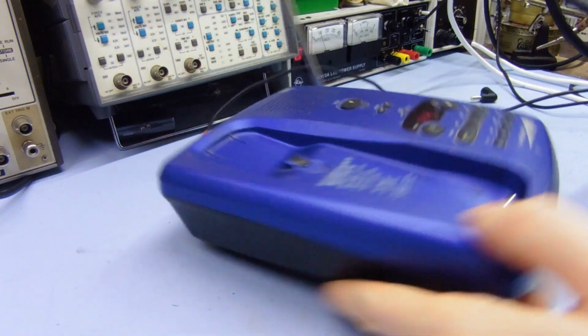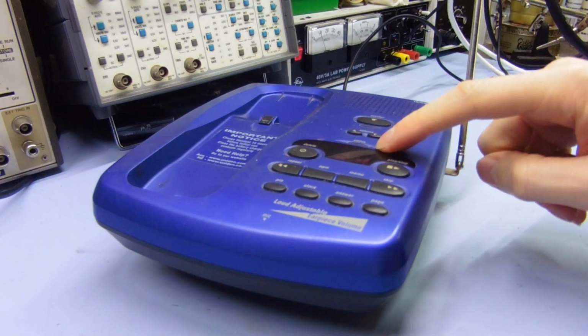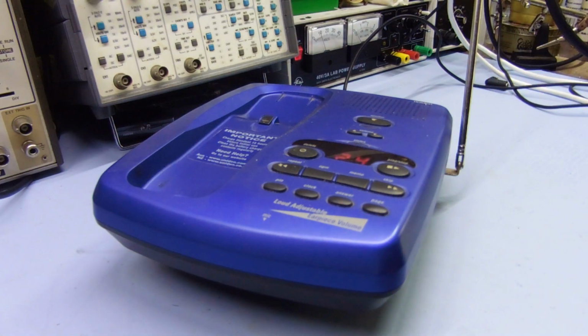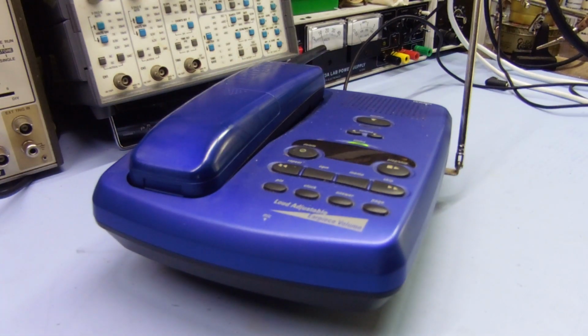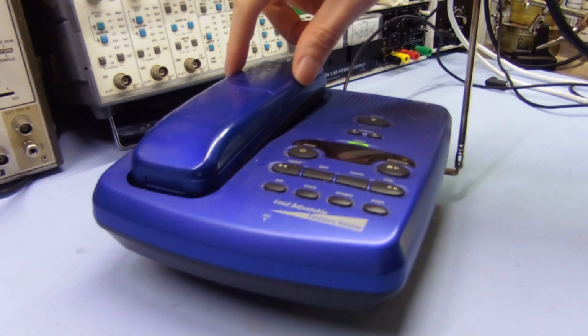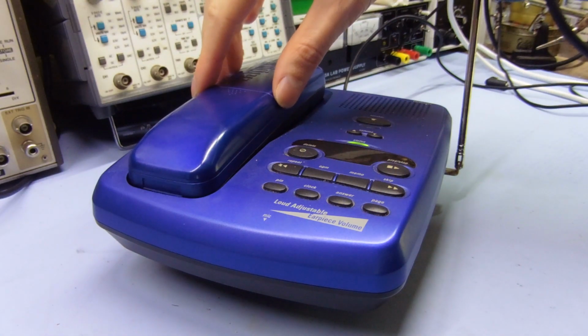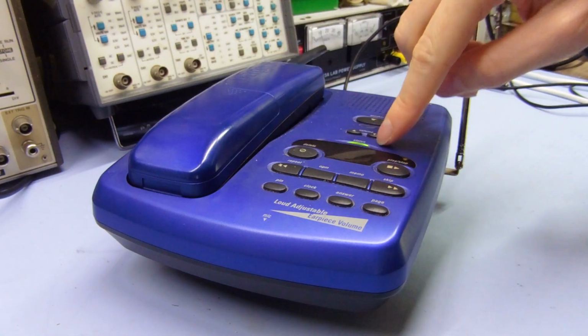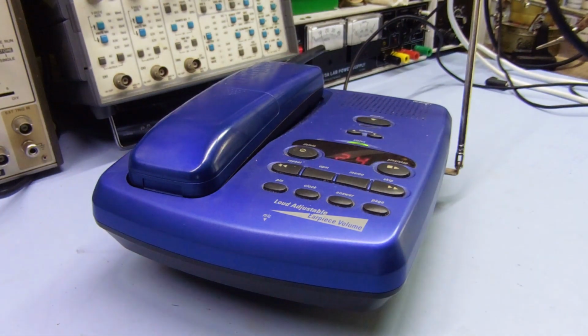And if I put this on here, you should see that's the charging light there. That one? No, that one. This one. Sorry, yep, that one there. This should come up straight away as soon as I put this on. Which it does. And if I jiggle that round, I can jiggle it up and down and the light doesn't go off. Previously, if I'd done this before, that light would be flickering the whole time I'm doing this, so it proves the connection is much better than it was.